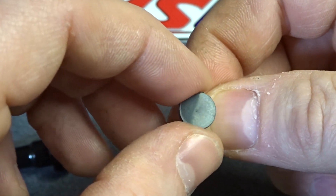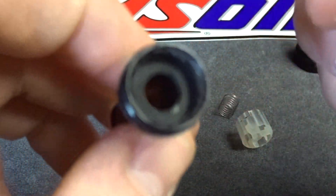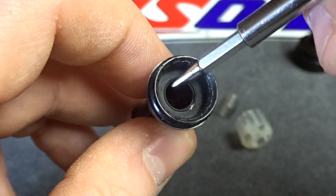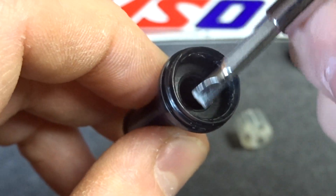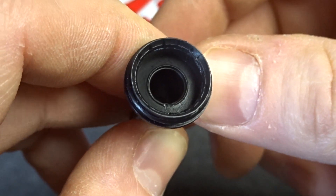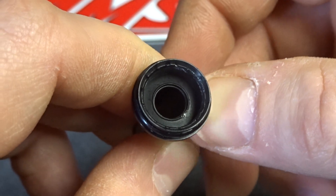In this case we've got a pressure rating of about 70 PSI. This is what that little plunger looks like. On the inside of this cap you'll see that there's a little ridge on the center, right there on the inside in the middle — and that's where the check valve actually seals up to. It should seal very well at 70 PSI or maybe even a little bit above.